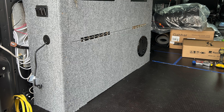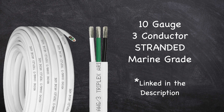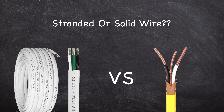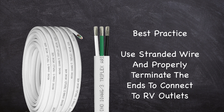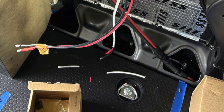Now that the inlet is installed, it's time to wire it into your system. You'll want to use 10 gauge, 3-conductor stranded marine grade wire. The question of stranded marine wire versus solid residential wire for AC wiring is often debated, but if electrical codes specifically addressed AC wiring in a van or RV, they would likely specify stranded wire. As a best practice recommendation, use marine grade stranded wire, properly terminated for use with automotive AC outlets. Whatever wire you choose, be sure to add protection wherever it passes over sharp edges, avoid tight bends, and secure it with plenty of zip ties to reduce movement.